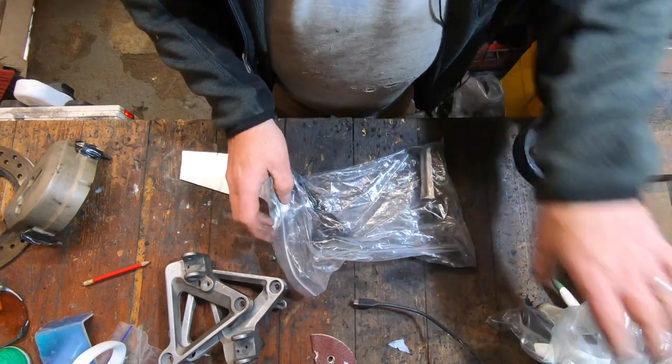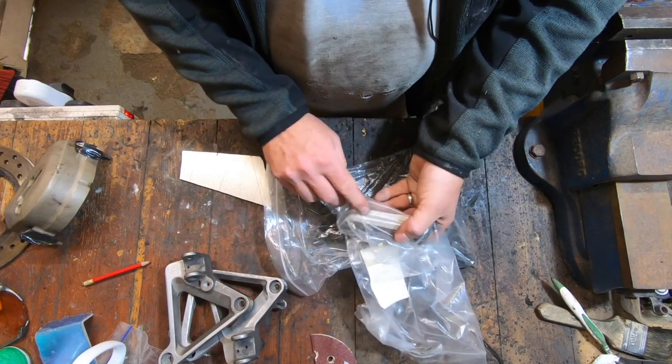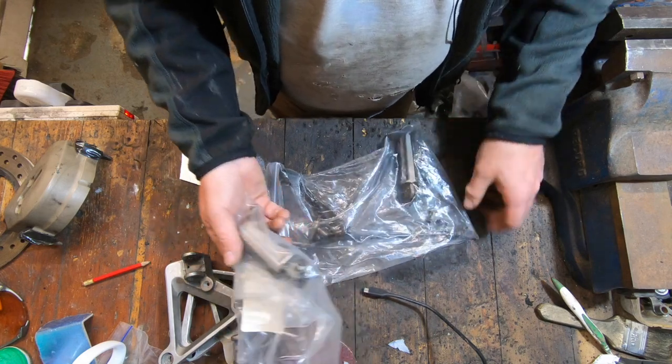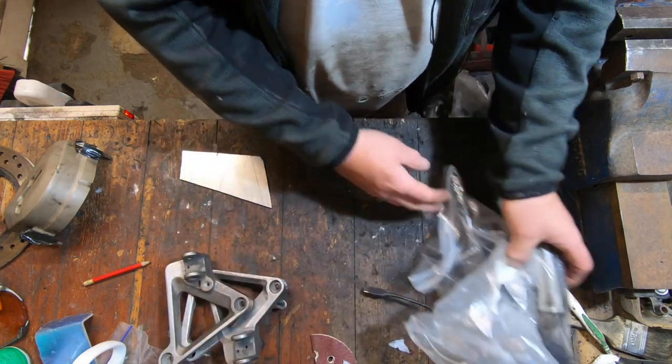I've got the other bits of the footrests to clean up. I'm just going to polish these up. I'm not going to powder coat these. Well, I could. No, I'm not going to powder coat them. So those bits are to do. So I think first job is to mark up this bit of plate, get that cut out, bent, drilled, tapped. Then that's another job out the way. Then I mark this up, get this cut out, and that's ready for paint as well, although I'll have to get some plastic primer. And I've also got, as I mentioned before, the thermostat cover, which was missing when I bought the bike. So I'm just going to rub that down, prime the piece of plastic, and that's going to be painted. Right, let's get on with it.